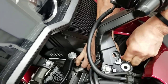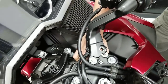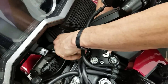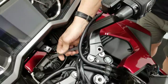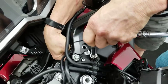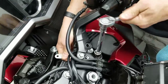This rod is a fixed length, so you don't have to worry about any form of adjustment. I'm going to reiterate how to square your steering here when we talk about all this. You simply put the nuts on and do the tie rod. Since it's hard to see where the wrench flats are, you can walk it around gently a couple of times until you feel the tie rod engage on the wrench. Usually once it bites, it's pretty good there.